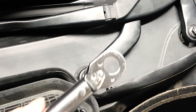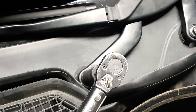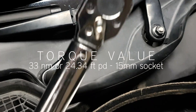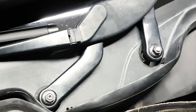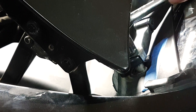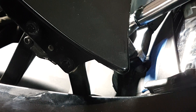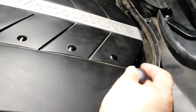You'll need an assistant here — not seen in the video, but I have somebody on the left side aligning the wiper arm to the painter's tape I put down when I removed it. That alignment is very critical. By the way, these nuts also press the rain repellent against the windshield even more.